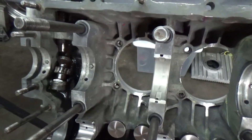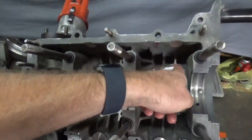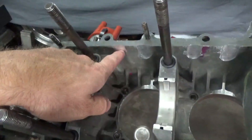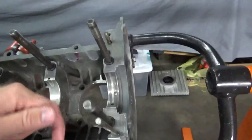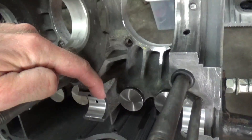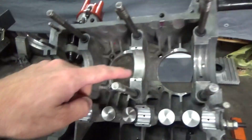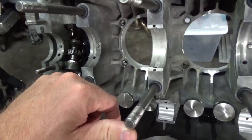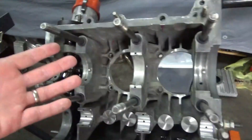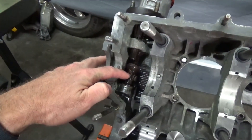You pay for using stock rods with a longer stroke by having to do clearancing. I used my air tool and a few burring tools. Down here it was just barely going to hit. Up here I had to raise the roof a little bit. The big problem area was right where the camshaft and all that goes — that took a little bit of time. I put the crank in to verify it, and I feel pretty positive it's gonna fit.